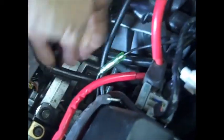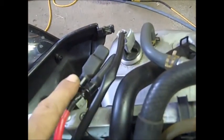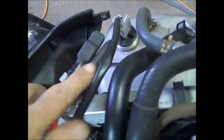Hook the little strap back up so the battery won't bounce around while riding down the mountains. When the strap is done up, make sure these two battery jump posts over here are back in their bracket so when you put everything back together you'll still be able to jump start if needed. Also make sure the starter solenoid with the fuses is in place.